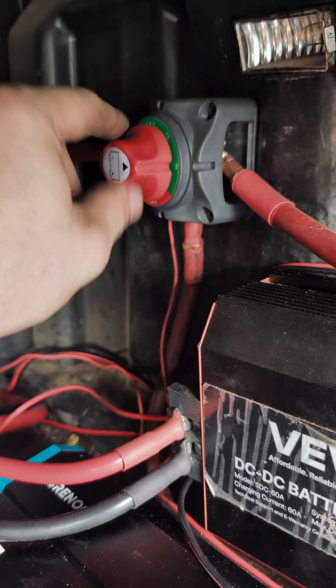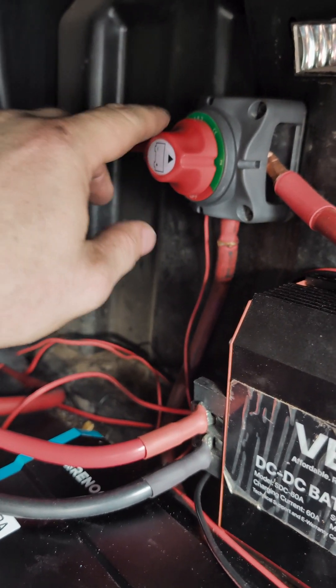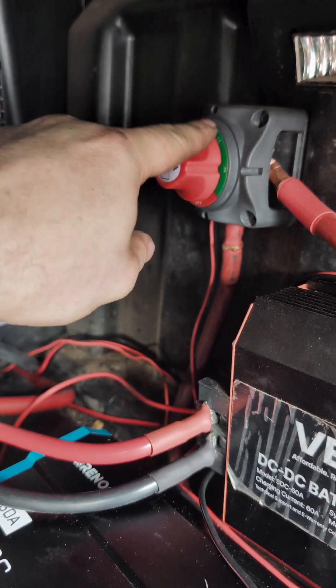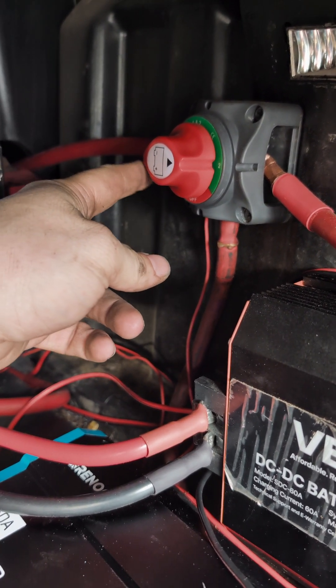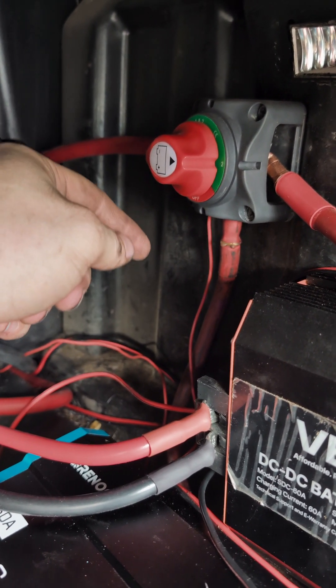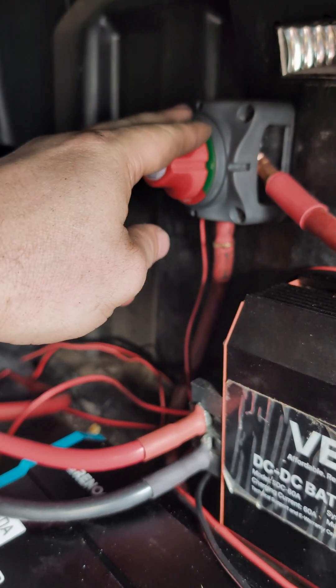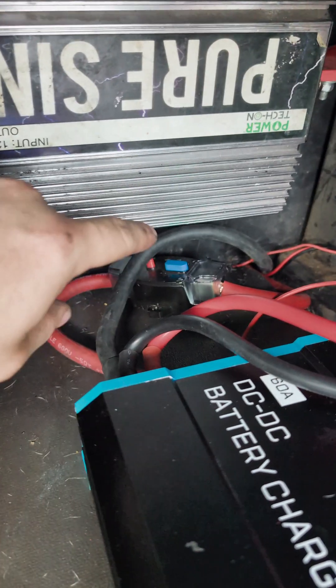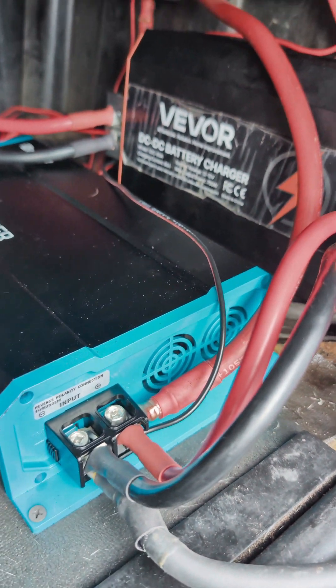Lastly, the very top one would combine these two together, which would be stupid, so you can't use the top one. So I've got charger off, and then lastly lithium batteries to the starter batteries. And this is a 200-amp breaker. We have an 80-amp breaker there. There are a few other breakers and fuses wired up.